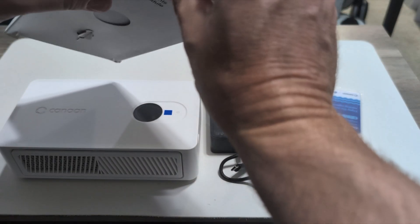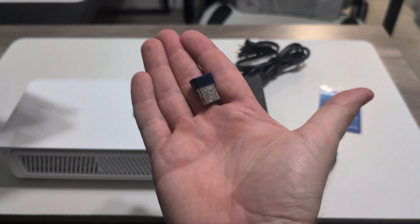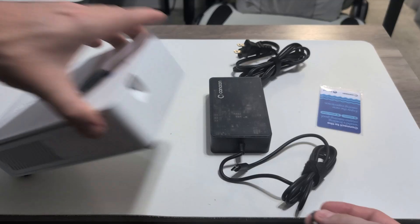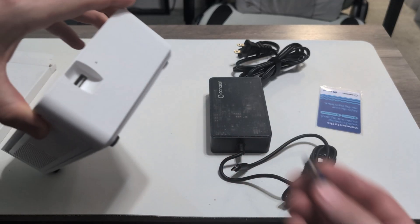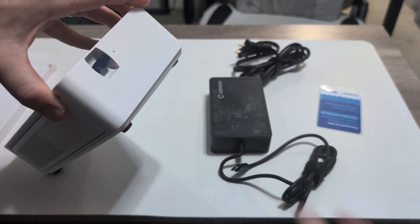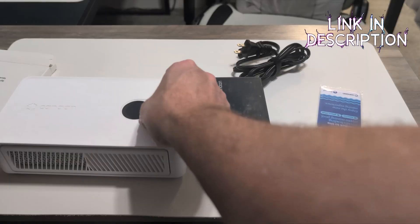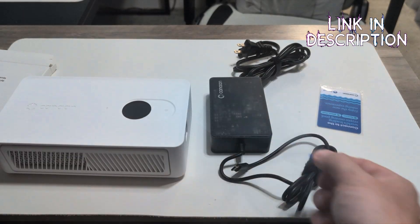In this slim package, it's very important to find the Wi-Fi module — it's located at one of the ends. After you find this, go ahead and plug it into the unit. Alternatively, you can purchase a USB to Ethernet adapter. There is a limited version of these adapters that are supported. I'll put a link in the description if you're interested in getting one of those to hardwire this to your network.